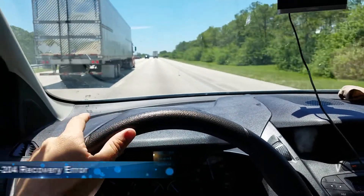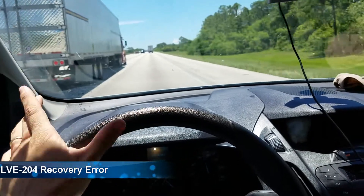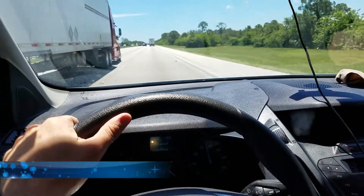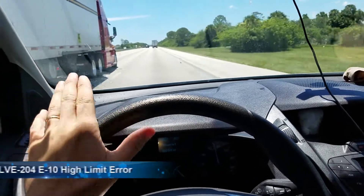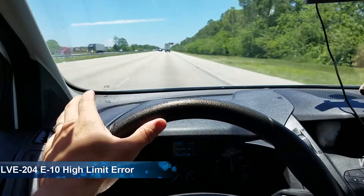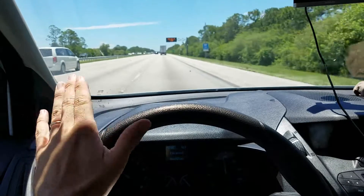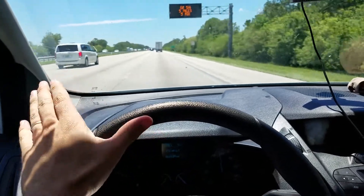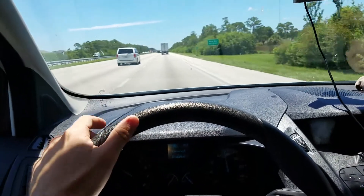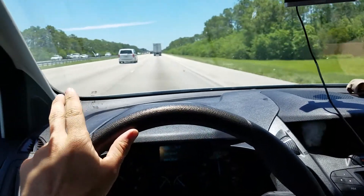Hey, Fryer Guy here heading to another call — a McDonald's LVE, which is a low volume electric 200 series fryer. They have a couple of issues. One is a nuisance high limit tripping, error code E10. Most of the time with McDonald's fryers, the high limit probes get a lot of carbon buildup and just have to be cleaned. Carbon buildup acts like a great insulator — almost like a jacket — and holds heat very well, causing the high limit to trip. They're not very good at cleaning their fryers or filtering properly.